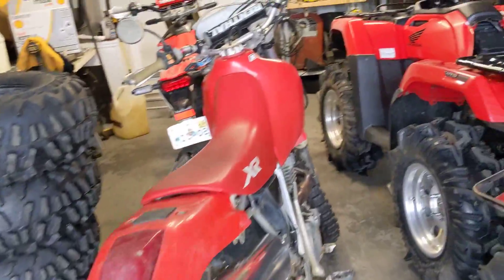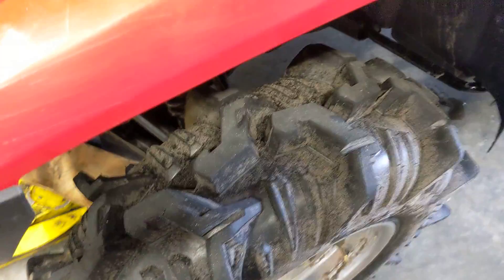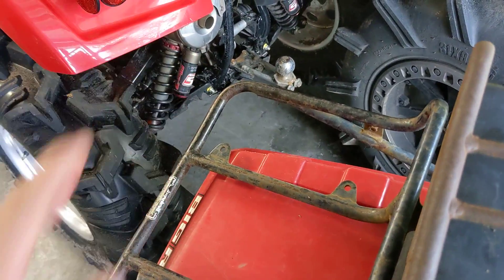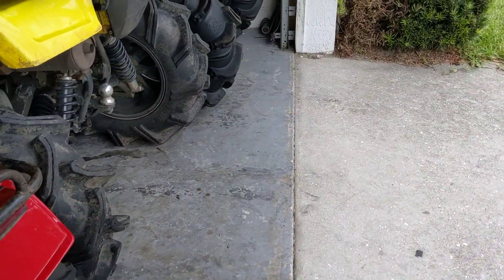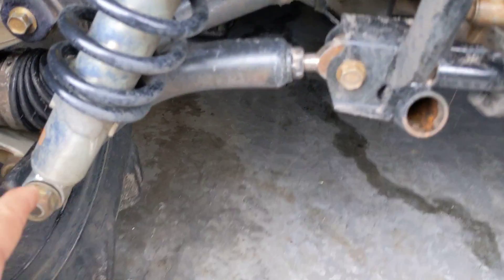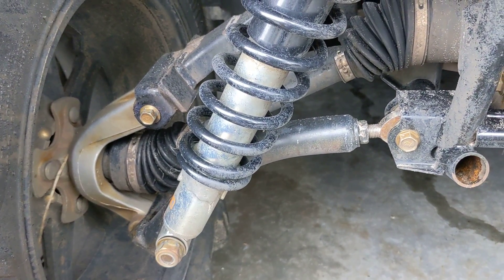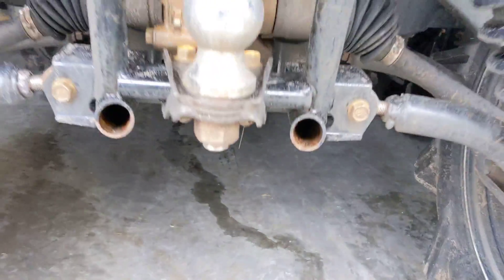I did get arched arms for the new Rubicon. My buddy Justin is still selling these — they're really awesome, they've come a long way. He's now using 5/8-inch tubes, so those tubes are a little bigger, really pretty beefy looking setup. These aren't raked — I have my raked ones off the green bike still, but I'm going to try non-raked because I don't plan on running monster tires on this one. I like how quick it is. The problem with any arched arm is from the factory your shock wants to bolt about here — you have to move that, otherwise you're not going to get any ground clearance from the arch. If you swing them out that far, you start to make it stiffer and because it's out so far, you lose travel. So the stiffness is good for hardcore mudding and maintaining ground clearance, like on this sucker.